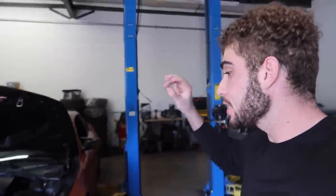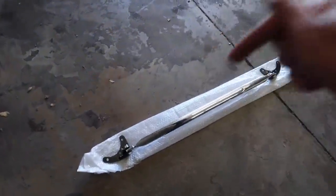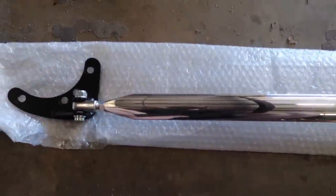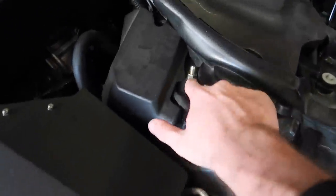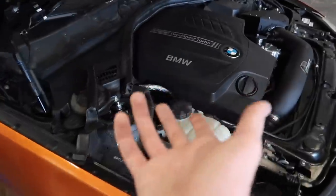There's one more mod I want to do before we get into the tuning. We are going to be tuning in this video and I also want to turn on the burble tune since it's a catted downpipe. The last mod for the 435 today is a strut bar - it's going to help out especially when we go stage two in terms of driving stability. We picked it up from Keys Motorsports - shout out to them, links are down below. It's made out of aluminum, super light, and it's a direct bolt-on. All we have to do is loosen up two bolts, install the strut bar, and tighten it up.